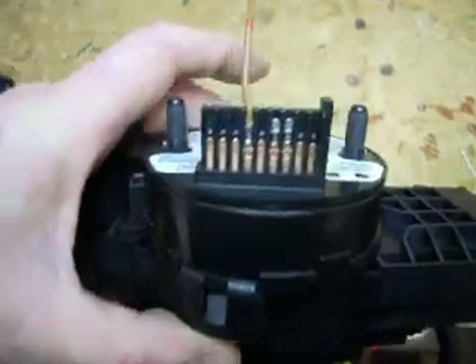So that's easy to do, feed them through. Now at the other end of the coil spring we have a different connector to deal with - this is a bit more tricky. It's the one on the left hand side here with five pins in it; the one on the right is the SRS connector, which we won't be interfering with. We have to use some SIL 0.1 inch connector sockets in there to connect onto those pins and we'll have to splice into the horn wire, but we'll also need four wires for our own use. So it can be done - it's going to be a bit fiddly but it's certainly not impossible.